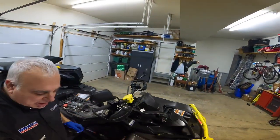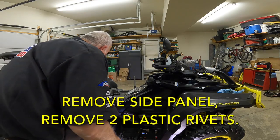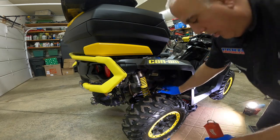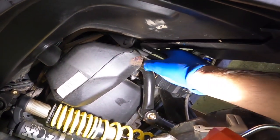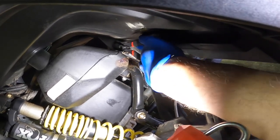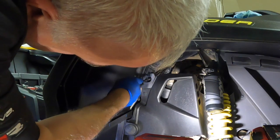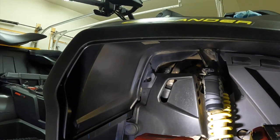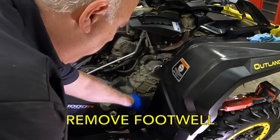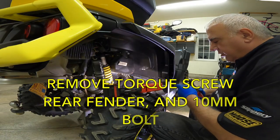The reason I pull the front shroud off is there is a screw right here that I always forget about — I think there's only one, maybe two. One more pin I've got to pull out in the inside rear fender. Then to remove the tub — that's another one that fights you — that bolt's going to come out last. Then there's one more push pin in the front fender, or plastic rivet. The oil filter we have to get to, and now we have to remove the footwell.